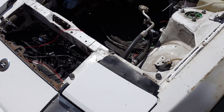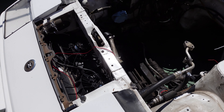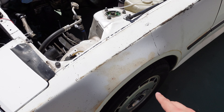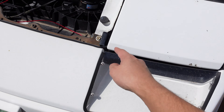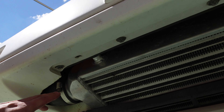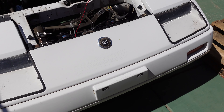I'm going to pull these fenders off too, but that might not happen this episode — just depends on what we get done today. I do want to pull off the front bumper and then work on that cross member and the steering. I think I might end up dropping the whole subframe and suspension assembly, so we'll take off the bolts up here and everything should drop down as a big unit. I'll pull the bumper first — it's three bolts along here, a couple bolts up here, one in the middle, one up there, and if you still have your stock bumper there are a couple under here too. Pretty simple and straightforward.